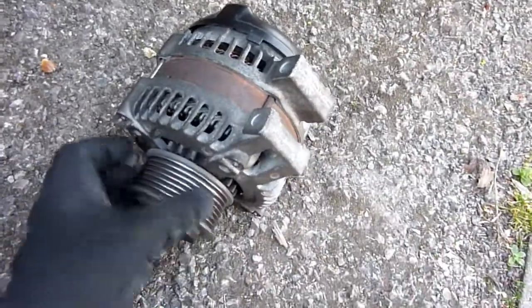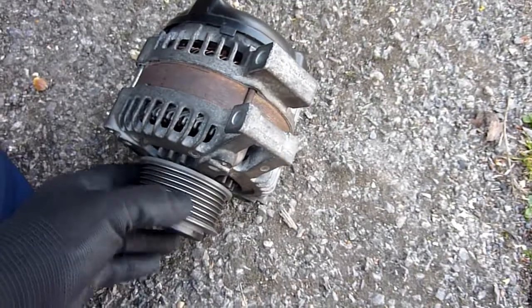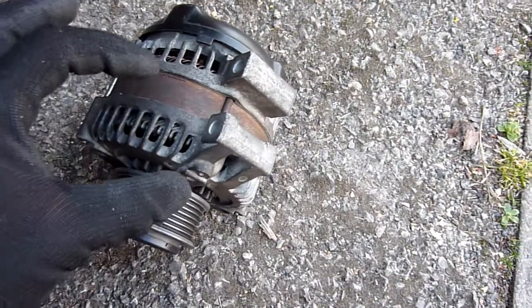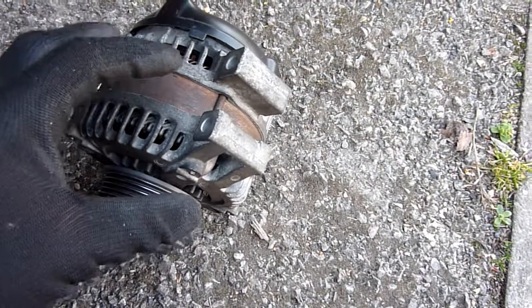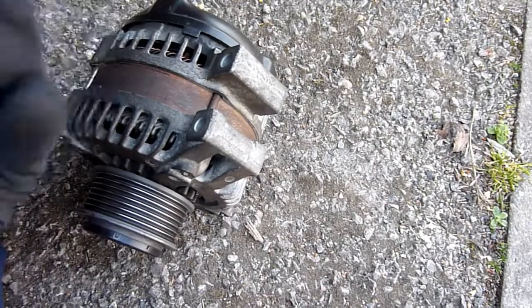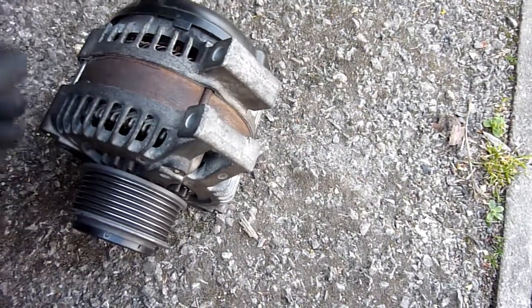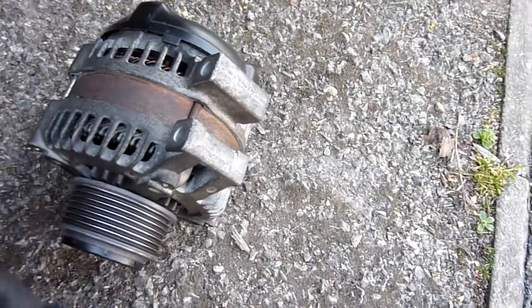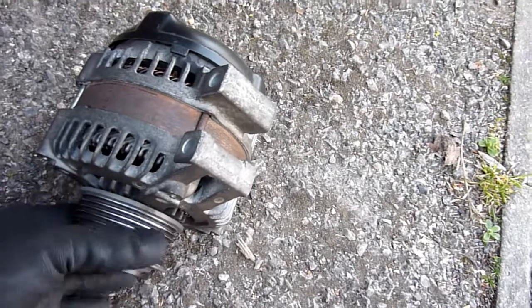It weren't perfect. The mistake I made was not getting the new bearing and just dropping it in the hole, to see how it fit. If I'd realised it dropped in quite easily, I wouldn't have been pushing it with a vise, because it should probably just drop straight to the bottom. So that was a mistake I made. Instead, I put it on the shaft first, didn't I, the small bearing. So that was a mistake.